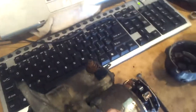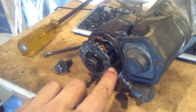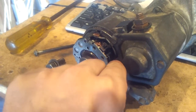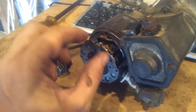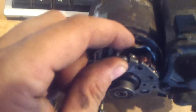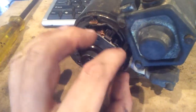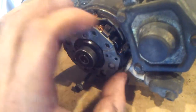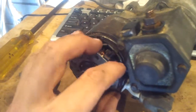Cory's come to my rescue and he's going to be bringing me a starter motor. So that's now reattached again. This time we're going to put some sort of plastic covering that has a little tongue that sits in between those two, because there are very fine tolerances around these brushes — that's positive and that's negative. Same thing again, positive and negative. It's a bit too close, so I'll put some plastic in between those in a cylinder. I might not need it now that I've done a better soldering job, but I might do it anyway.